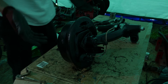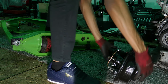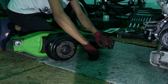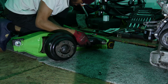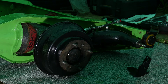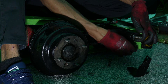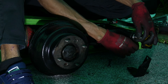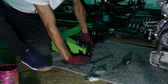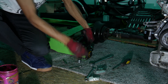Let's see if we can get it fitted to the subframe now. Before I do that, I always like to do a tiny little spanner turn on these nut holes here — I'll put a tap inside them just to make sure they're clear before I start. I've got all the half-inch bolts in place now, just nipping them up. I've already used a 19mm and a three-quarter inch to lock up the main pin that runs across the radius arm.